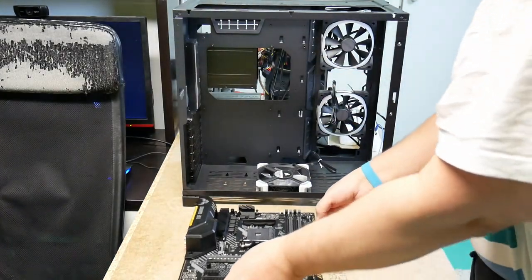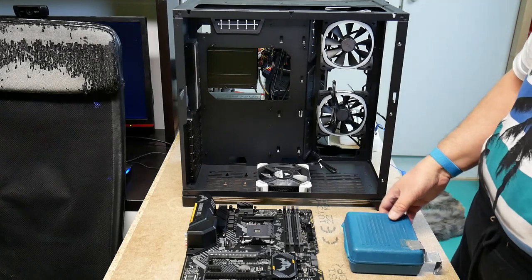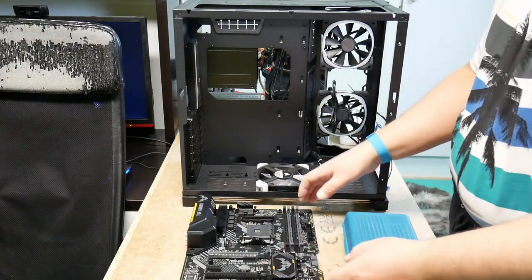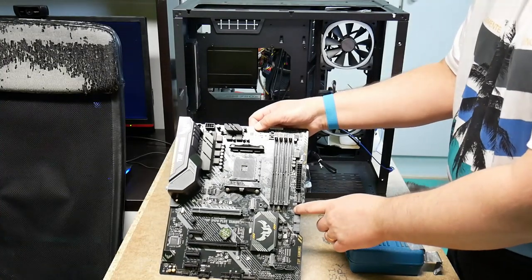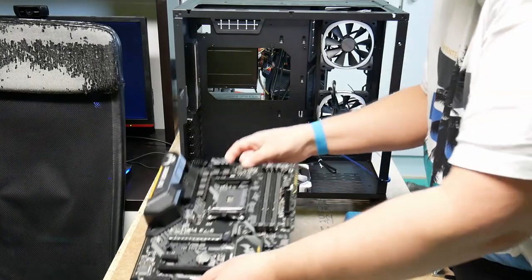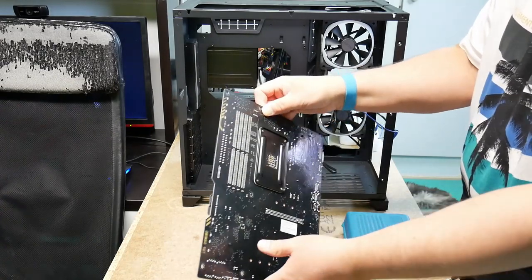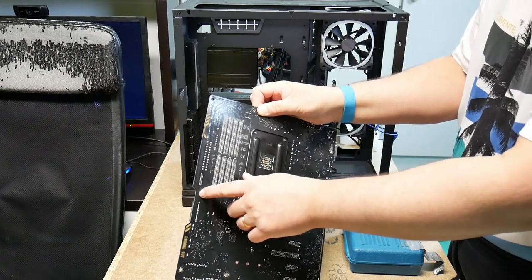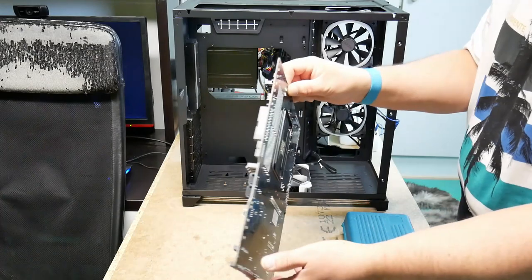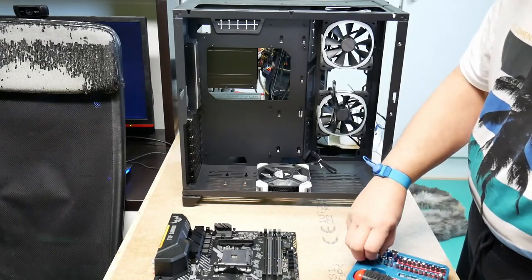We do have one standoff that needs to be removed, and it's that one. So I just need to bring some tools over. So that was a good check. Before you populate the motherboard, because now it's lighter to move around, one should check the status of the standoffs. And as you see, this motherboard doesn't have a screw hole there, but it does have a standoff. If one screws it in, then potentially one can short circuit something underneath, because it's not meant to have a knob there, so it would be in line with those two, in that area. It might not cause a problem immediately, but when the motherboard shakes around or you transport it, it might get banged enough to take away the protection on the motherboard, and then you create a short circuit.